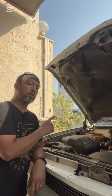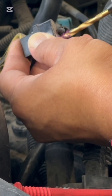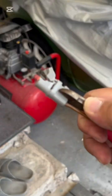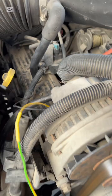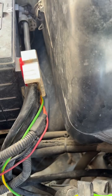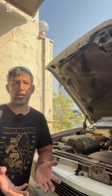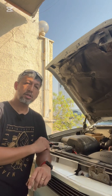We installed the sensor wire — we drilled a hole on the connector and then tried to find the right size for a female connector. We actually destroyed one of the connectors from my reserve parts. We ended up directly wiring it to the battery, because what the sensor wire does is it tries to sense what your battery voltage is.